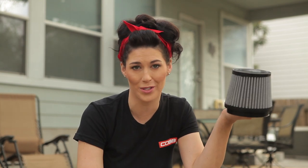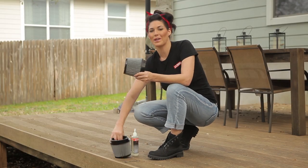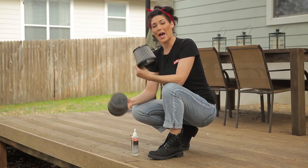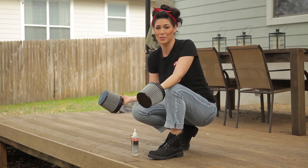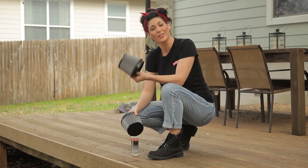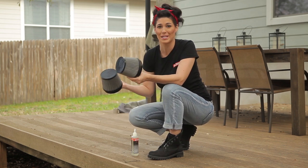But seriously, don't over-oil your filter. It's the opposite of a haircut — you can always add a little more, but if you do too much you're going to have to start all over. One round of oil will do the trick. One thing you might want to consider is having a backup filter on hand. That way, when one filter gets dirty, you just pop in the other one, and sometime between the next 10 to 15,000 miles you clean the dirty one. This way your car has less downtime.